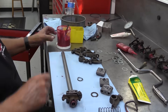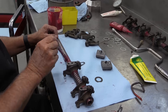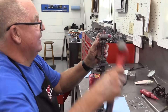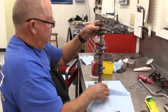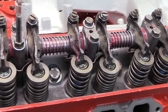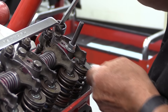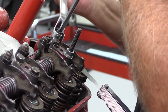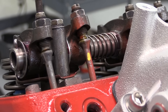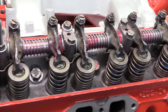The rockers and stands must be assembled on the shaft before anything is bolted up to the cylinder heads. If you aren't careful the rocker arms won't center up over the valve stems, so shims are used to ensure the rockers are directly over each valve. The lash is set to 19 thousandths cold. Some people like to set the lash a little tighter because they've found it helps cut down on valve train noise. Dorton also marks each pushrod with a yellow paint pen — since this is a solid lifter valve train, if the lifters and pushrods don't spin, that's the sign of a flattened cam lobe, so the mark lets you check if each pushrod has rotated.